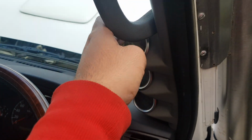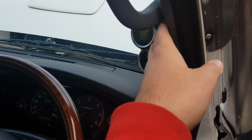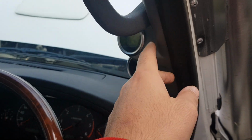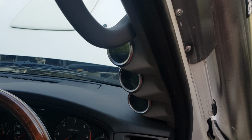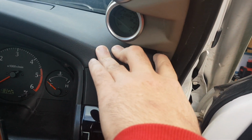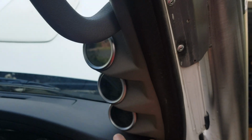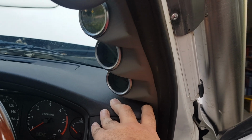The pillar covers you can change if you're doing a wagon. Also the B pillars, C pillars, and the roof line you can be changing in the wagon. In a Ute they can't, so I just reused all my old top halves, which doesn't look too bad. There's an extra tab in here that you have to trim off to get these to go in, otherwise they won't fit properly, but you can get away with using them, cutting a little off the end of it.